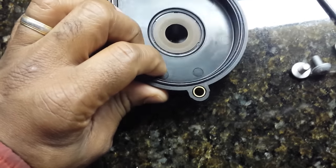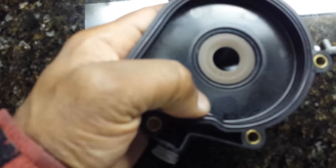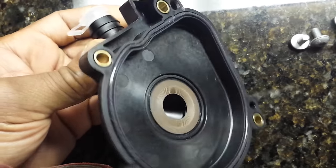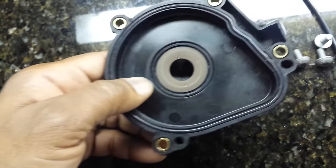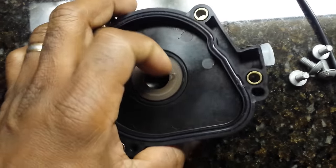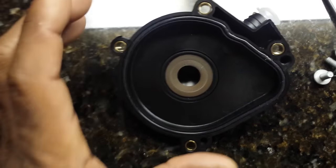The other reason why you want to change this: over time this little rubber diaphragm right here — it's soft — will get hard and brittle and it too will crack and break. You can end up with pieces inside your air intake manifold that can then clog your flaps, your internal flaps. I spoke about that in the previous video — just look it up under air intake manifold failure explanation on my channel. It can also allow an excessive amount of oil to bypass this rebreather valve, going down into the hose and ending up inside your air intake manifold, which will cause those flaps to get coated with oil and soot, making them harder to turn until they break.